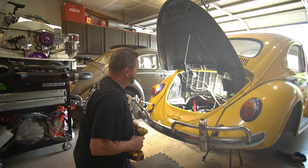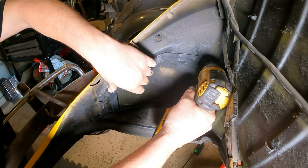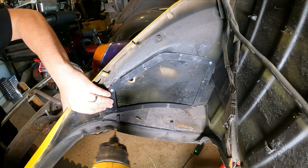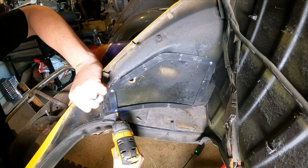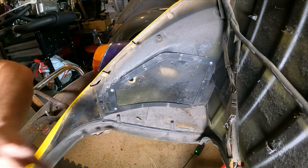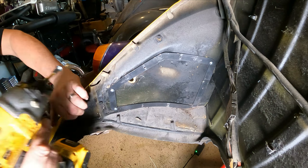First thing I've got to do is put that frame in there and secure it. We're going to use some of these self-tapping screws and our trusty impact - which just happens to match the car - and we're going to use the existing holes here. Just going to shoot a couple in there for now. That one didn't grab, some of this metal is a little soft - we're going to fix that later. This is going to give us an idea of where to cut, what part we've got to cut out, and also where the holes have to go. Because you've got to blow those holes out before you weld this on, and you want them to be bigger so that you can find them with the screws later. So using these little tech screws is going to kind of mark the center of those holes for us.